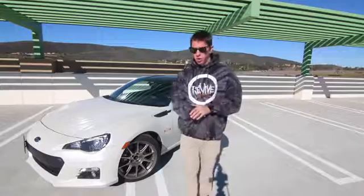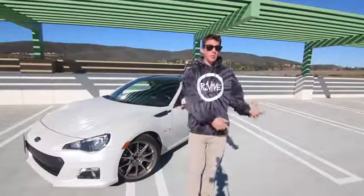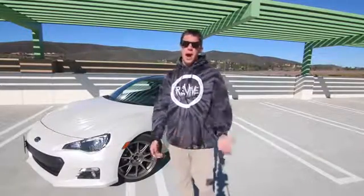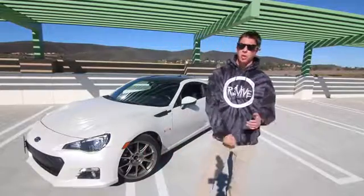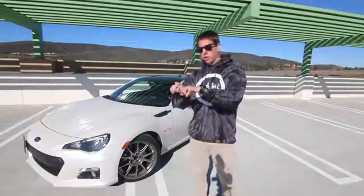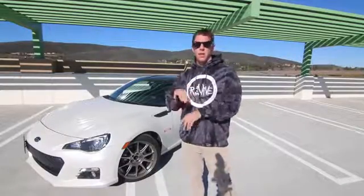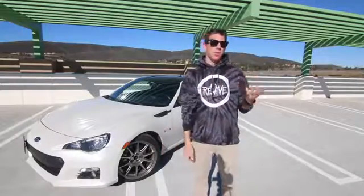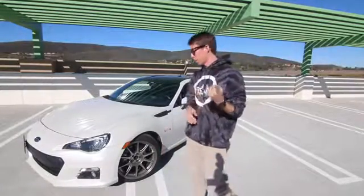I think I'm gonna go supercharger just for reliability issues, and mainly the turbo that I was gonna get, they were supposed to make it CARB legal, but they ended up blowing that one out of the water. So I have to be CARB legal here in California, which a lot of turbo kits aren't. So I mean, there are some. Don't mess with me and be like, this turbo kit is legal, you liar. I mean, there are some, but they're pretty expensive, and they're less reliable due to heating issues. So I think supercharger's the way it's gonna go.